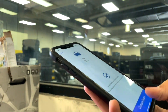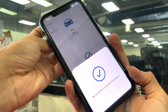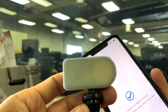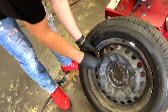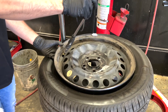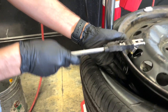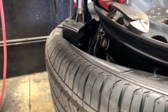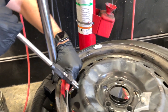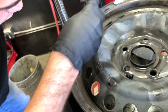The sensor's white side must be placed on top of the side of the phone where the NFC sensor is located. Programming is pretty instant and you get a check mark indicating the sensor has been programmed. When installing the TPMS sensor into the wheel, be careful not to break it. I prefer to unscrew the TPMS sensor with the valve so that if I have to pull it hard, I won't damage the sensor.